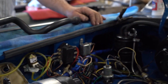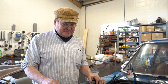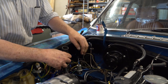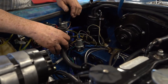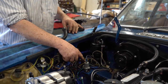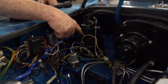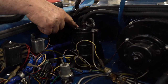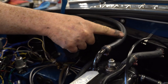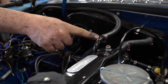Let's watch what happens to the air when the engine is running. Air enters the bottom — I haven't got this hose installed, but this goes on the bottom of the anti-run-on valve. Fresh air enters this, comes through the anti-run-on valve, which is open as long as the key is on, goes through the charcoal canister, up through the charcoal canister, and out here, and is drawn into the valve cover through a 5/64ths hole.